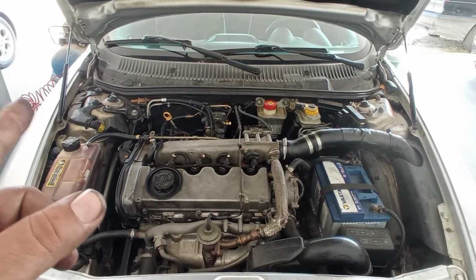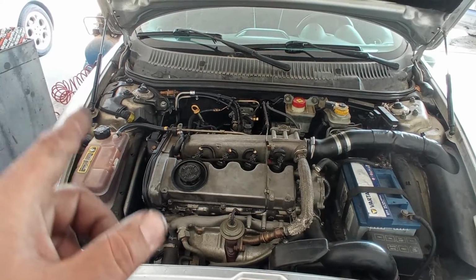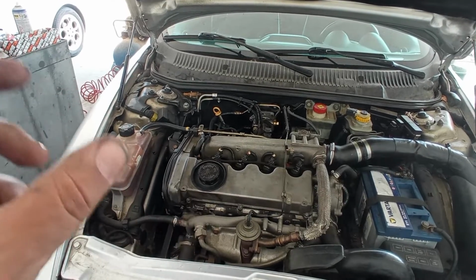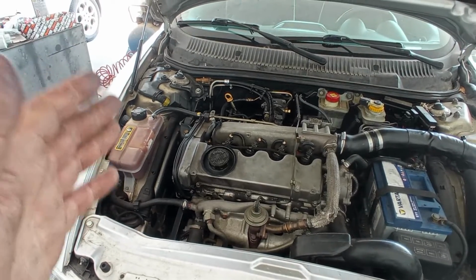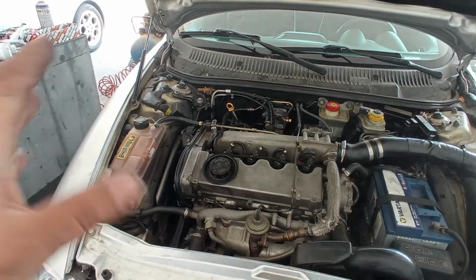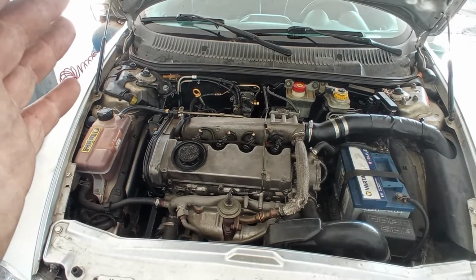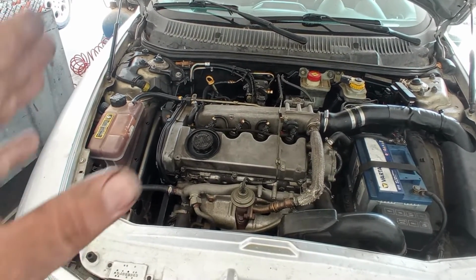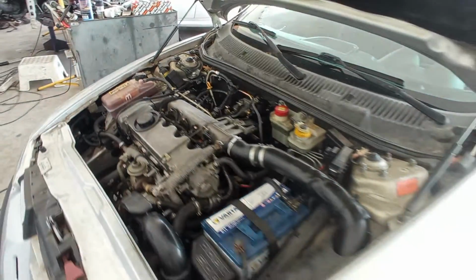About that, I did the testing of the low pressure, and I made a mistake. That gauge is new, and it is new to me also. It does not have a bar scale. It just has pascals and psi. Well, I did not read that correctly. What it actually read was 2.5 to 3 bar, okay, which is nice for these cars. They do measure 2.5 bar instead of 3.5 or 4 on these early versions, so everything is okay. But I am sorry for that mistake, okay?